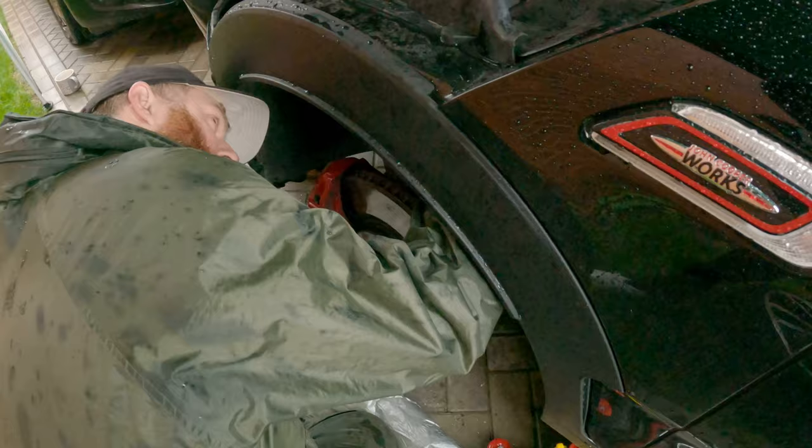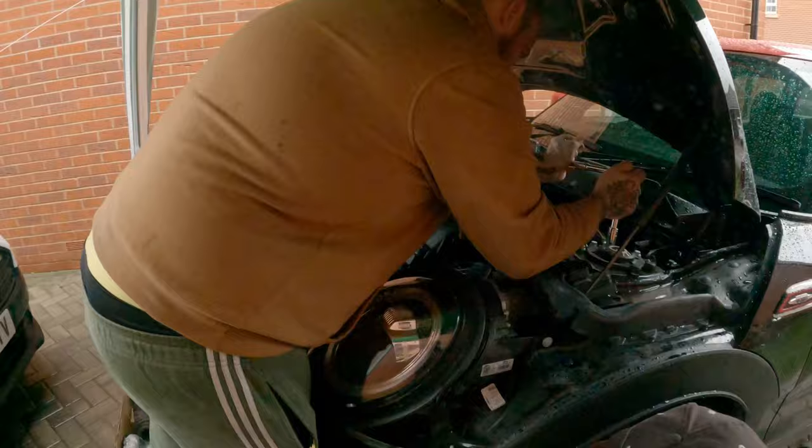So now Stu can obviously relax - he's not holding the pressure, the nuts are on. He's just going to finish off doing them. I'm now reconnecting the drop link. With the drop link you need both sides jacked up and that takes pressure off it - if you only have one side jacked up you won't get it on. That's a good tip there for you guys. So right, that's all tight under there now. That is literally the front done.